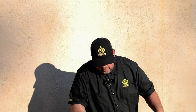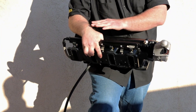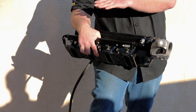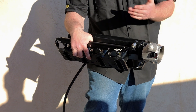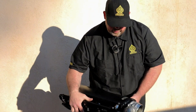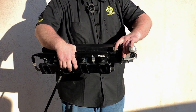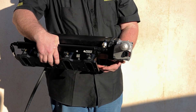On the fuel rails you can see here we're using EV1-style injectors — this is a Pico body, short body EV1 on our rails. I'm using these because they're 65-pound-per-hour injectors, which adds a slightly different method of tuning and getting it set up. It gives you guys a different idea of some of the things you need to do. The fuel pressure transducer is right in here on this side because the fuel comes up and in in a weird way — we'll cover that when I go to install it.